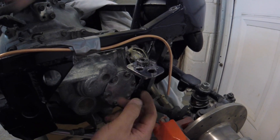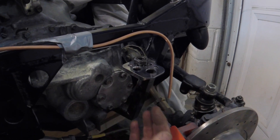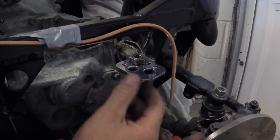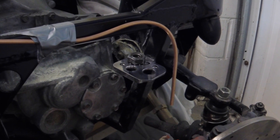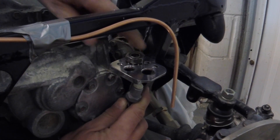The tip I have is just when you come to this part of the subframe — I've got the later 1.4 gearbox in here so it does stick out a bit more — just trial fit your brake pipe with the gearbox in place, just to work out where the bracket should be.